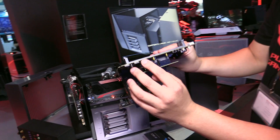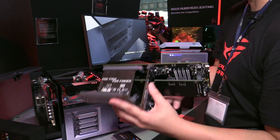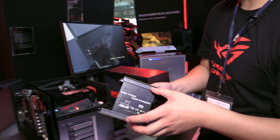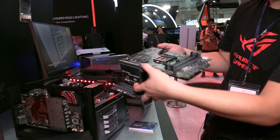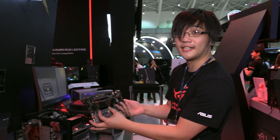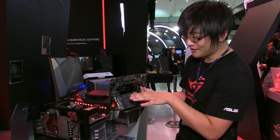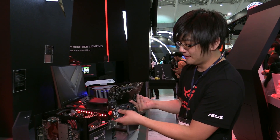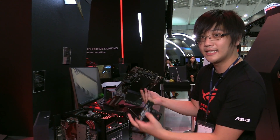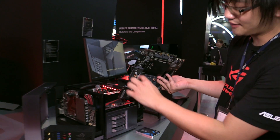Here's the internal structure of the motherboard itself. The shape of the motherboard is designed to fit the case properly, which is why we're able to have front panel Type-C ports directly on the board. The VGA adapter board is what allows us to sink down the video card and raise up the motherboard while keeping installation easy. The front panel uses a static connector — you may have seen this in high-end cases — but typically those still require cables running back to the motherboard. By designing the motherboard and case in tandem, this connection uses the PCB itself to transfer both power and signal.